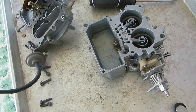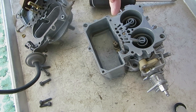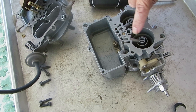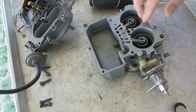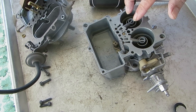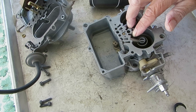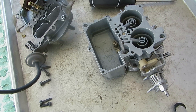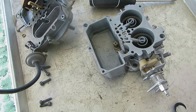So that's how you test it. The main thing is you know you've got fluid going through so there's nothing stopped up. From there it just goes out to here. And if you want to try it on the car before you even take it off — start it up, make sure the float bowl gets full, then you can turn it off and pump the accelerator a couple of times and watch. Make sure you have two nice streams coming out of here for your accelerator pump. And that's how it works. Thank you for watching.